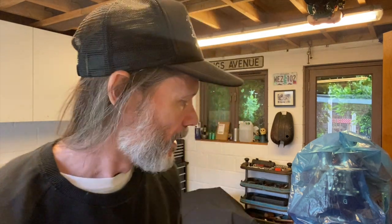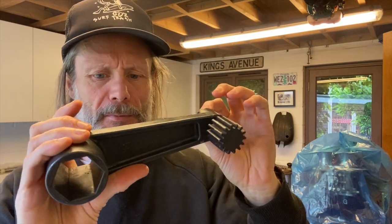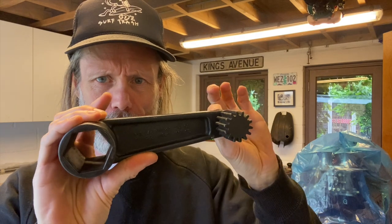Now if you've got a slightly performance engine like the one I'm currently building, you need a slightly better than average flywheel nut so your flywheel doesn't fly off at high revs or hard acceleration and destroy everything. I always do my flywheel nuts using the Torquemeister tool, which has a gear that attaches and goes against the flywheel and then multiplies torque by nine, so you can turn it round and torque the nut down. I think this nut has to go to 350 foot pounds, so that's a lot of torque.